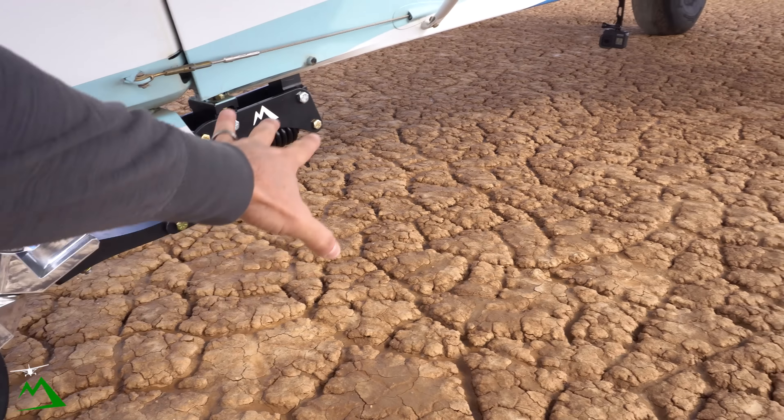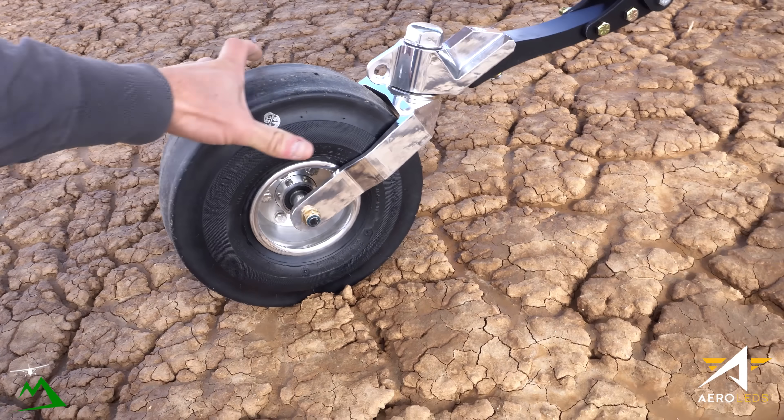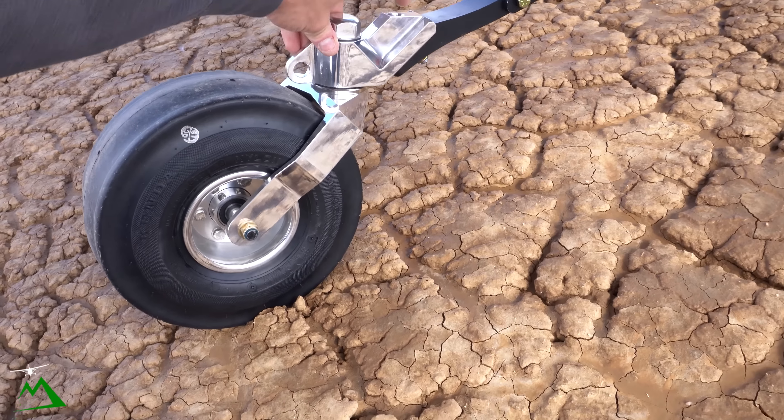All the black part is what I designed. This right here is a tundra light tailwheel — so beefy, love it. And it's actually a lockable one; I just don't have it hooked up for that yet. I wasn't sure on what spring rate to get. That's a thousand pound spring, but because it's a cantilever suspension, it's like a three to one ratio. It needs to be stronger.